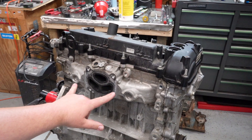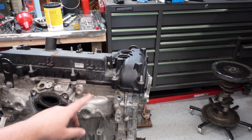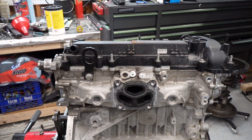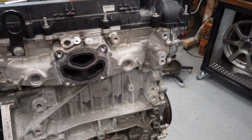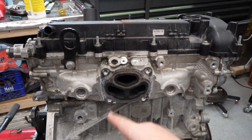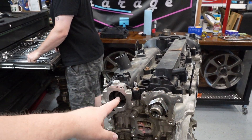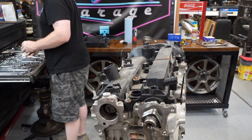There's no exhaust manifold either with the turbo. Well, technically there is an exhaust manifold — it's an integrated exhaust manifold, so this is the manifold, it's part of the head. Coolant can run through here so they can run more boost and hotter exhaust gas temperatures. The reason for this weird port design here is that this is for a twin scroll turbocharger. Cylinders one and four go to one scroll, two and three go to another scroll. Also missing: the high pressure fuel pump would have been here, and there would have been a vacuum pump here for accessories that need vacuum, like the brake booster.